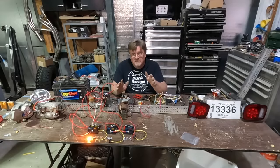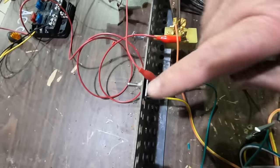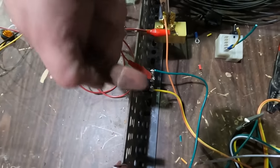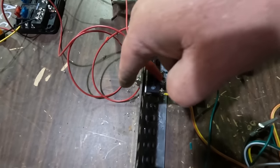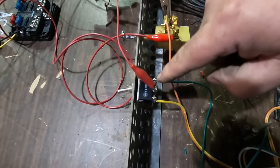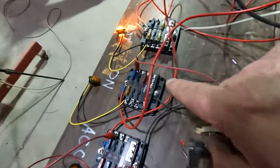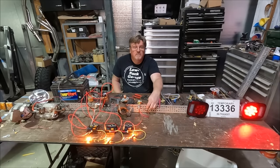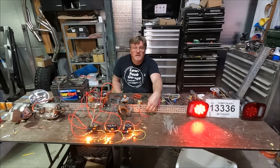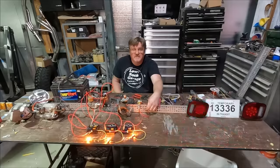It's time to think about turn signal lights. The easiest way to add them is just a simple double throw switch with left and right turn signal lights hooked up to either side. One thing to note about these switches is they're on a pivot — when you switch it this way the other side goes that way, so keep in mind it's the opposite when you want left to go left and right to go right. I'm hooking up power to the on position since I only need signal lights when the vehicle is on. Move it to one side, move it to the other — I can even blink it manually. This would actually work as a turn signal, but it's not fun to keep sitting there blinking it back and forth.